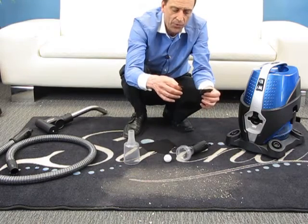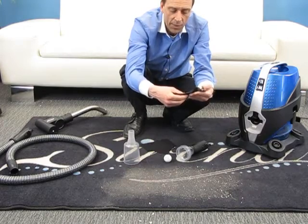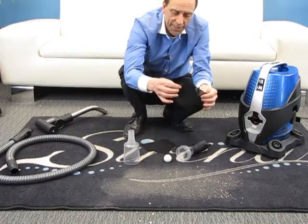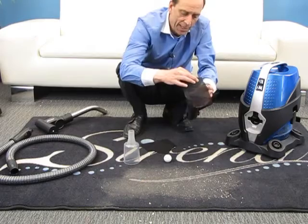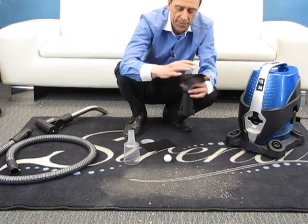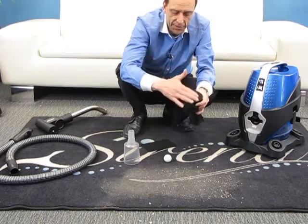If the bag was not full of holes, it would expand like a balloon and explode, so it has to have holes. Now, what happens is the dirt clogs the holes, which reduces airflow and your cleaning efficiency. So we're going to take a couple of these and simulate a bag system. The holes in this are way too big for traditional bags, so we're going to double it up. Now, if you have a bagless system at home, that just simply means that you have filters instead of bags somewhere, and the filter is probably even less porous than this cloth is.